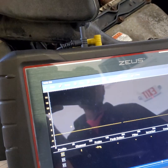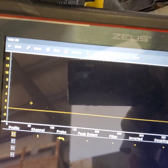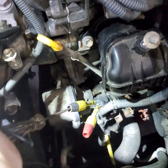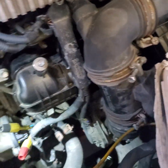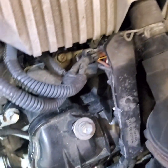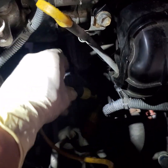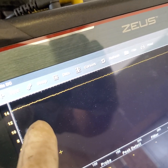Let's move on to the smaller gauge wires on the scope. I'm on volt DC. I'll move my ground lead and put scope lead one on the ground and the other on the power. As you can see, I have 14 volts — because this is a hybrid system, key on engine running gives good battery voltage.